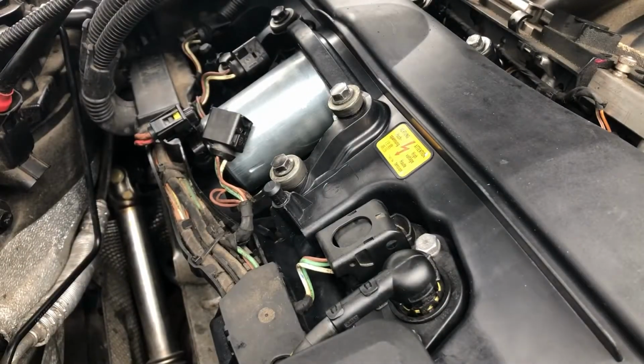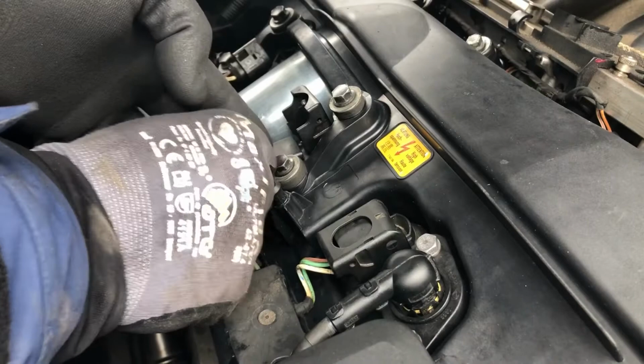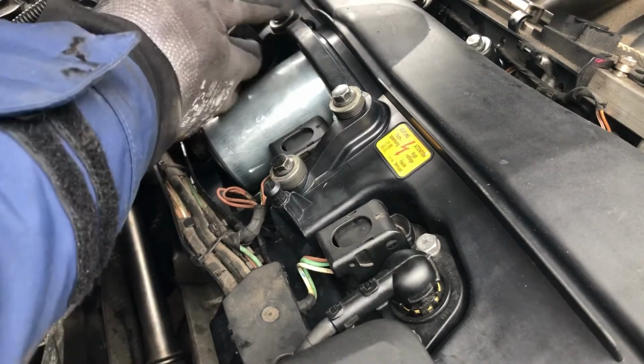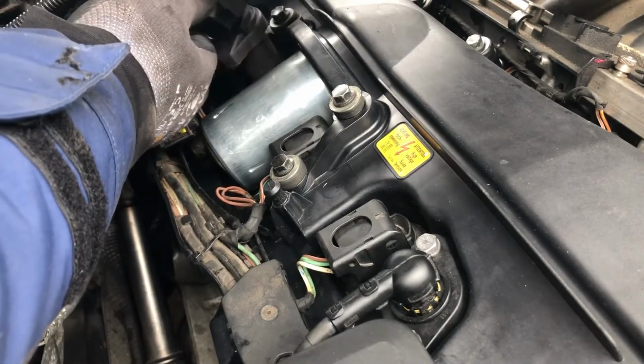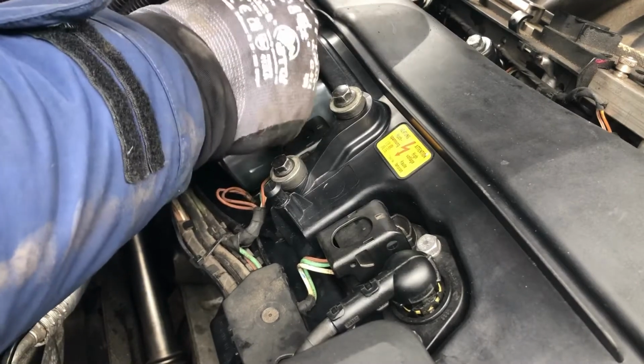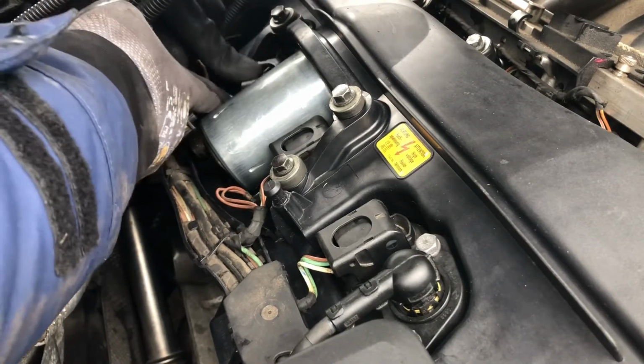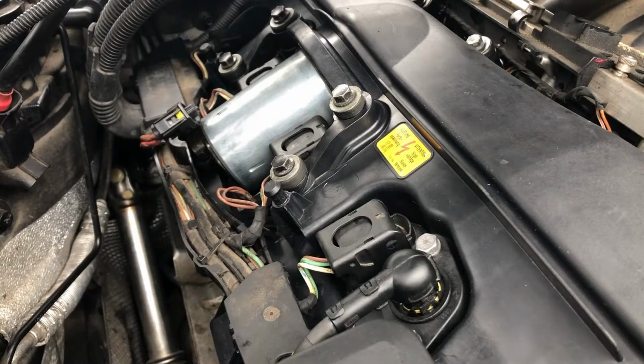Push them in together, remember, a little snap shut. Number 2, like I say, I number these, so it's always a good idea with coil packs to know where they came from. To be honest, they're all the same, but number 3 was the new one. This one's had a replacement at some point or other. In there, 1, 2, 3, and snap. And number 4.